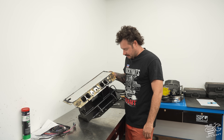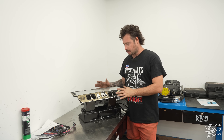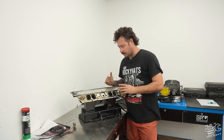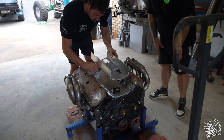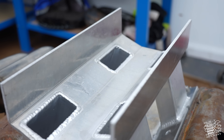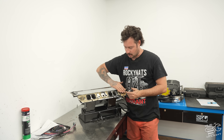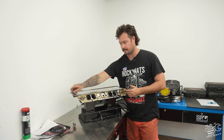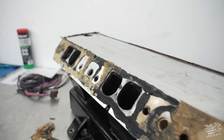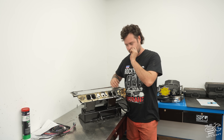This has been the biggest pain ever since we built this thing. The dramas with making a manifold, especially out of aluminium, is it's going to warp a lot with welding. When Paul first welded it, we had both flanges bolted to the head, he TIG welded it and then let it cool, but it obviously still got a bit of tension when you bolt it down. You really want it to sit relaxed on the heads and perfectly seal — that's pretty tricky to get right. We then got it fully machined at the engine shop, they put a deck across it, and ended up having to take about two mil off to get it flat. That's quite a lot — that's about a gasket thickness. So I had to go with thicker gaskets, we crosshatched both surfaces, and then used a ton of sealant.